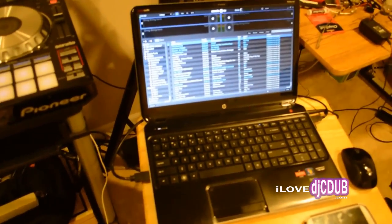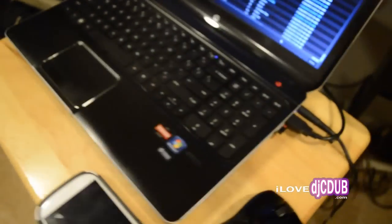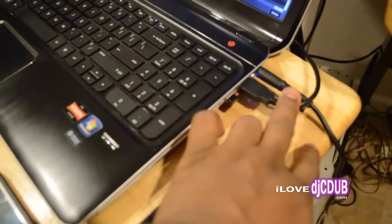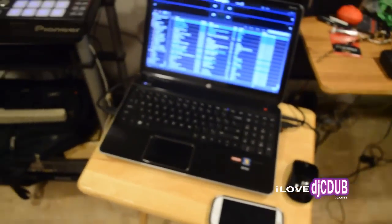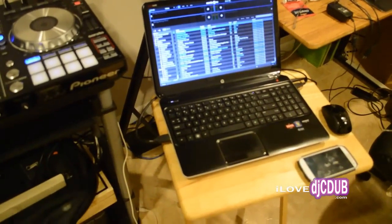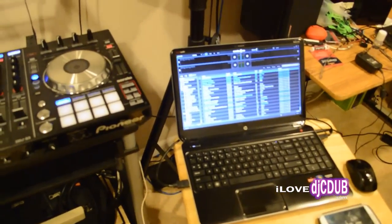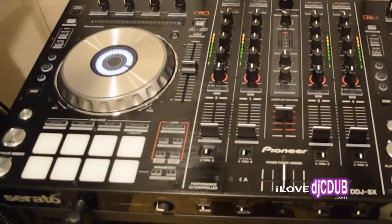The way I got it working — the first thing you should try if your DDJ-SX doesn't work is to go around to your computer and try all the different USB ports. If it doesn't work in one port, try the next. The weird thing for me is that the port it ended up working on is a USB 1 port, and the rest are USB 2.0 or 3.0. It didn't work on the newer ports but worked on the older one. This computer has 8 gigabytes of RAM and runs everything with no problem.